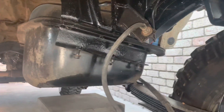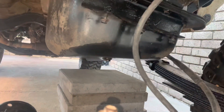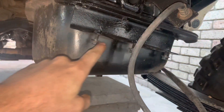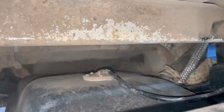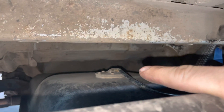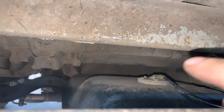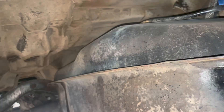Right YouTube, it's the next day and we're gonna get this fuel tank out — it's been drained now. Got these bricks stacked up to catch it. There are three bolts here and three on the other side. There's a fuel line over there that I hope is already loose from the body lift. Once I get it a bit lower I'll disconnect that electrical connector, and there should be some fuel lines on the other side too — not much room to see up there.